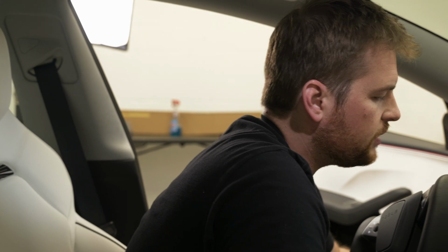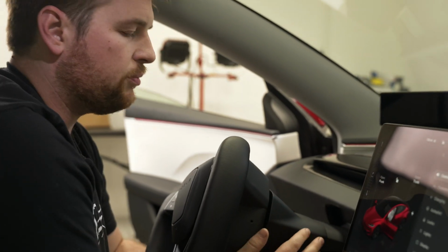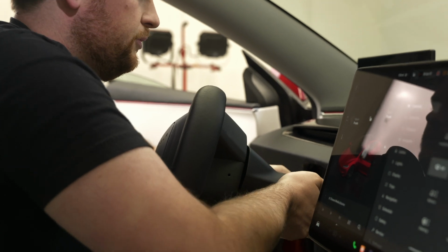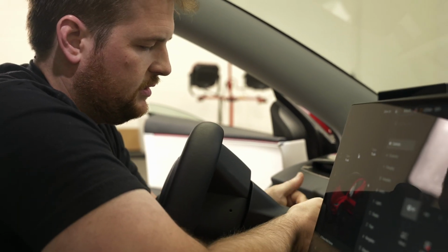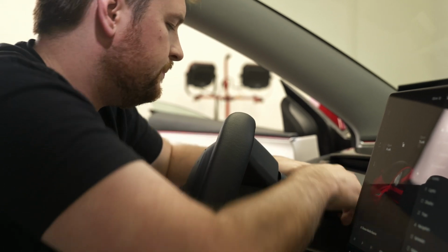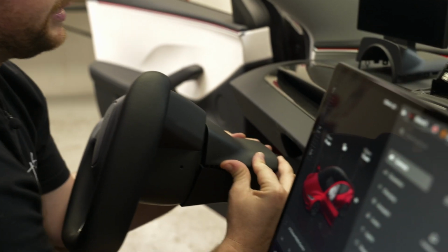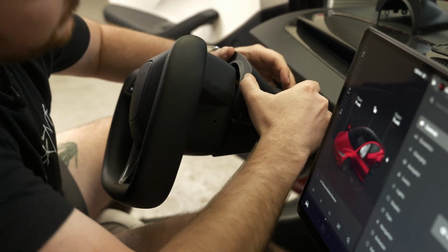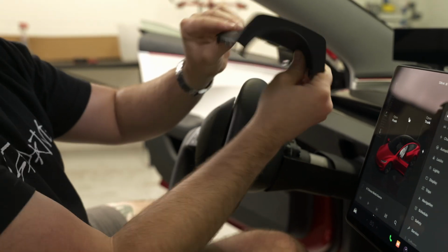Moving to the steering column cover, you can either use a pry tool and get between these gaps, or you can use your hands to sandwich the plastic to have the ends pop up. Just work your way around it to pop the cover off.